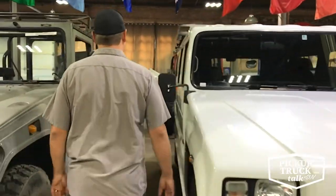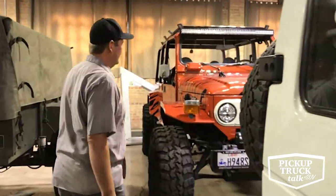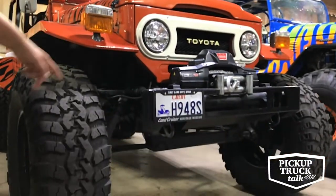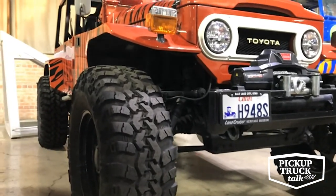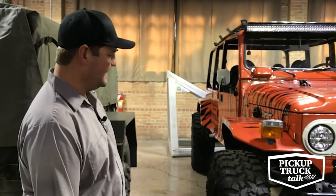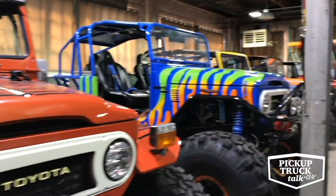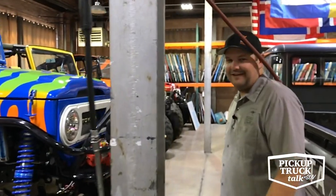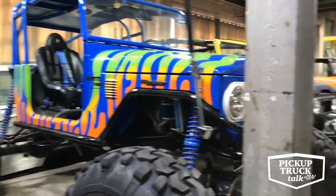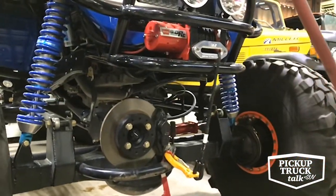Sneaking back to the crawler row — not pure Toyota DNA, but they're just fun. This is a four-door aluminum 40 series body on a Mega Cruiser chassis, which gives you a good look at how much ground clearance those Mega Cruisers have. It has larger tires, four-wheel steering, four-wheel independent suspension, lockers front and rear, and the portal reduction hub. Then you have the Lizard King — just a big Land Cruiser with two-and-a-half-ton Rockwell axles and a GM V8. And a few more crawlers including the Bug and Big Red on the end.